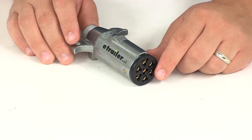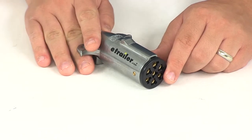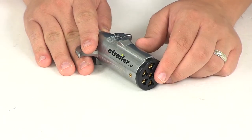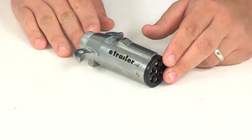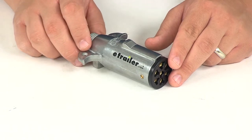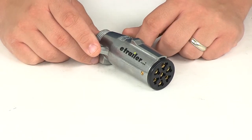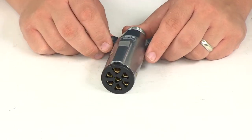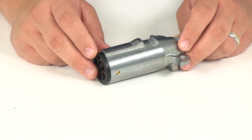When it comes to wiring configuration, we recommend the following gauge wire by color and circuit. White is your ground — we recommend 8 gauge. Black is for clearance, side marker, or identification lights — 12 gauge. Yellow is for left turn and hazard signal — 12 gauge. Red is for stop lamps and anti-lock devices — 10 gauge.